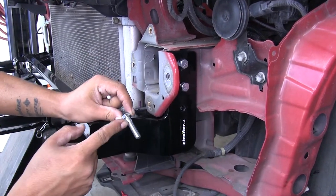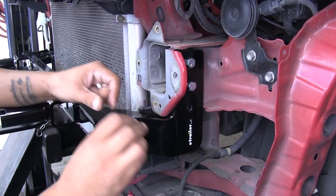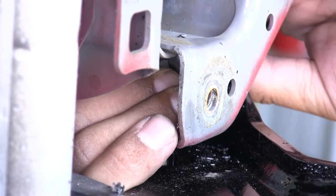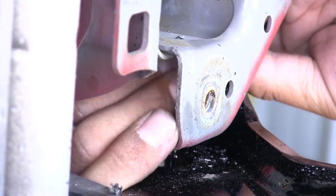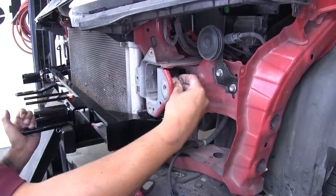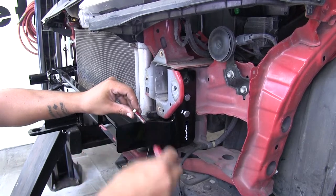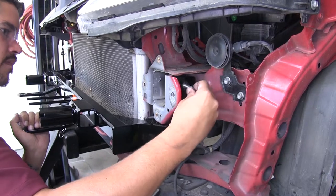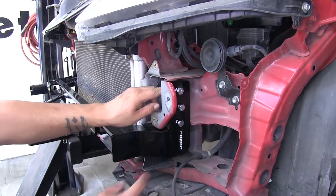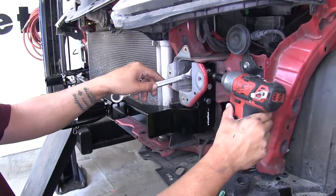For the bottom hole, take one of our longer bolts — it has a small shoulder on it — and again apply a little bit of Loctite to the threads. Go through the bottom hole and secure with another lock nut. The easiest way to get these lock nuts in place is to reach underneath and behind the base plate — you'll have just enough room to get that nut started. With those in place, remove the top bolts to apply red Loctite, tilt the base plate back into position, and re-secure with the lock nut. Repeat the same process and hardware combination on the other side, then snug up all hardware with the 9/16ths wrench and socket.